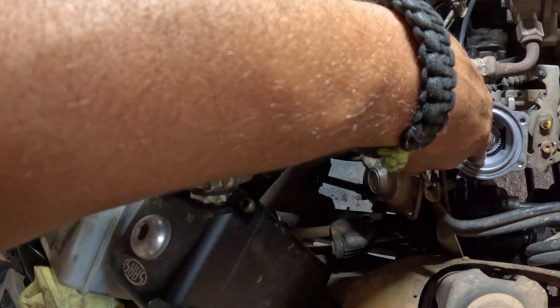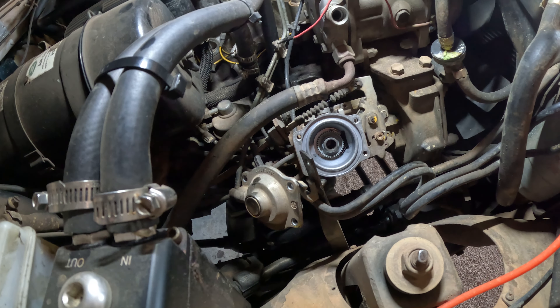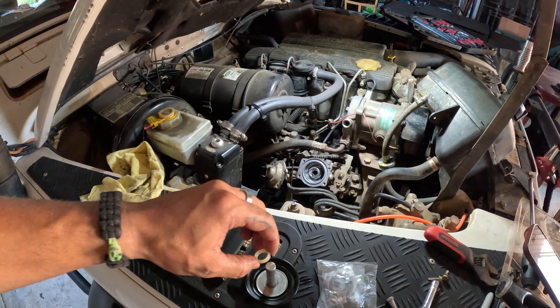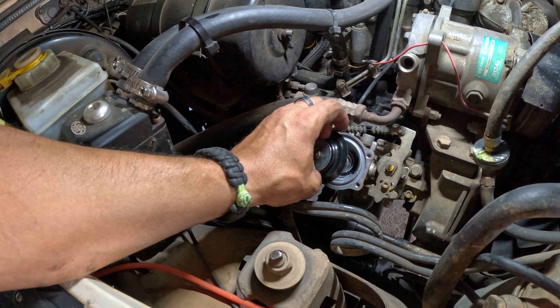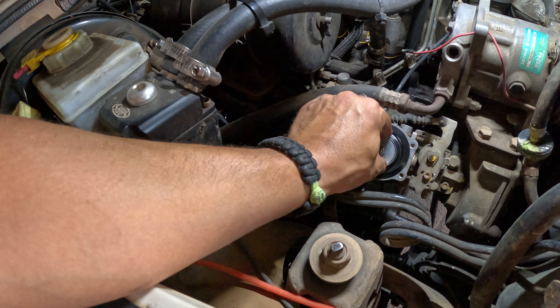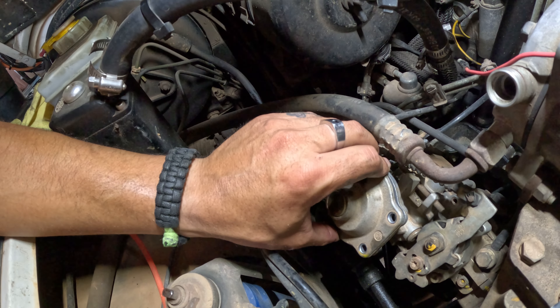Under 80 — okay. As you see, the mark is up on this side and now the mark is gonna go over here. Literally three-quarter of a turn. And this is gonna help — don't ask me the technical because I don't know, I just follow instructions — but it's gonna help with the resistance of this spring because you're gonna lower it down, so there's less resistance, so the boost comes in faster. And then I forgot the ring — put it back like that. Okay, and we go this way. And this one is done, a little bit nervous.